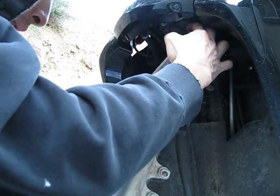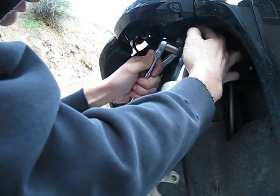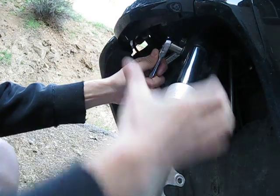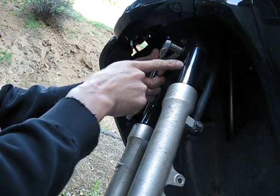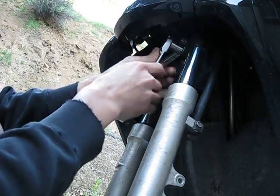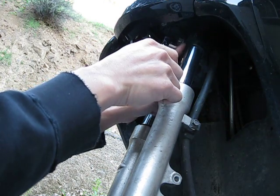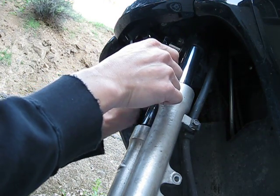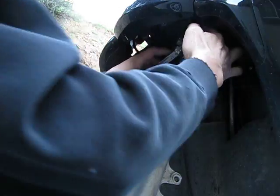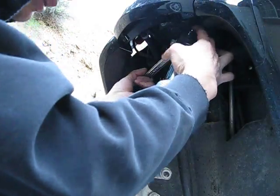So I'm actually at a good angle right now. I'm going to tighten this up a little bit. Remember, it's only the bottom leg that is tightened, because if you tighten up the top bolt, this clamp here squeezes the stanchion and that's where the thread is — it squeezes the thread and you won't be able to loosen up that top cap. Even if you do the bottom one too tight, it'll still squeeze, so just a little bit only.